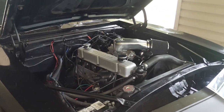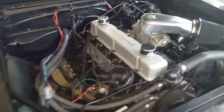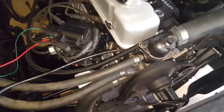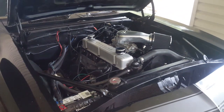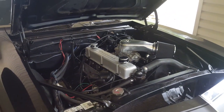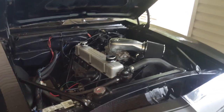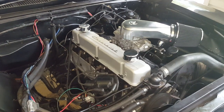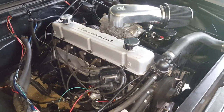We're going to be doing this with the engine off, and it's already been broken in. The engine's been broken in and now we're going to be checking and doing the adjustments again. I had an issue shortly after break-in where one of the rocker arms turned sideways and I could hear a horrible clacking from inside — it turned out to be that. So I'm not 100% sure if I've got some bad rocker nuts, and I'm going to be checking those as well as redoing all of the adjustments.